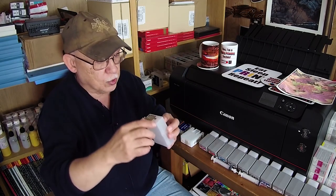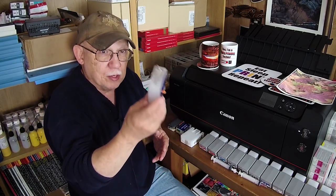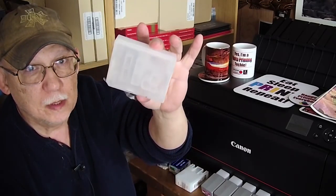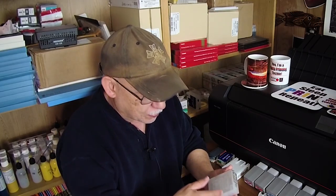I modify these to refill them while they are still in the printer, but that's not the way they come — they only come with one plug. You add ink here, and this little circular chamber will be devoid of ink; you will have to prime it. That chamber will then fill up with ink and ink will be available to the print head. Otherwise it's not going to provide ink to the print head. Once you get it all done, it's pretty reliable.